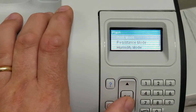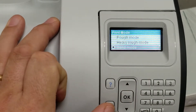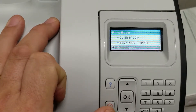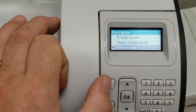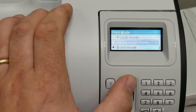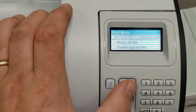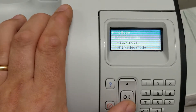The first thing to play with is just print mode. As you can see, we have ours set to bond mode. Bond really slows it down, makes it hotter, and runs it through the fuser more slowly, giving it more time to iron that toner into the page under higher pressure. By default, it'll come in light mode or normal mode, which gives it the fastest performance. However, you may not get that great micro adhesion.